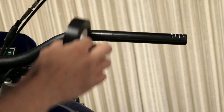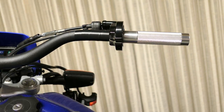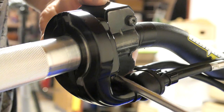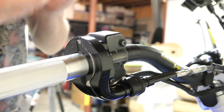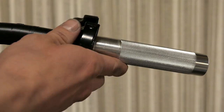I'll go ahead and zip tie the main harness back to where it was making sure it has plenty of room when you turn lock to lock, then reinstall the headlight and front cover in reverse order making sure everything is tucked in nice and neat. With everything removed on the right side of the handlebar, I wrapped it in some electrical tape up to about where the alignment pin on the throttle would be. Then I installed the throttle tube, switch cluster, and brake, keeping everything loose so they could move freely. I moved everything to the exact spot I wanted and then tightened down the switches and throttle, making sure there was enough slack on lock-to-lock turns.